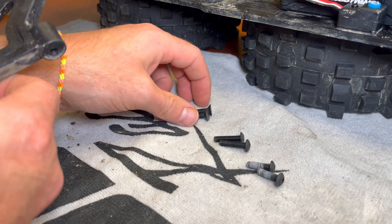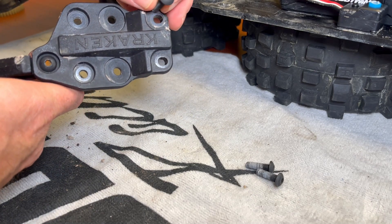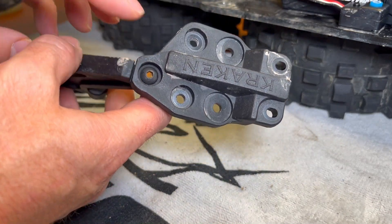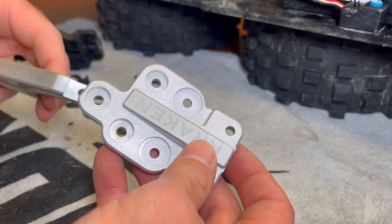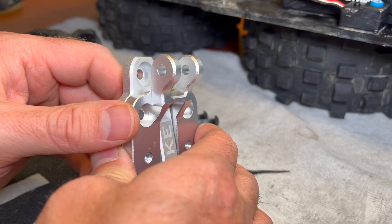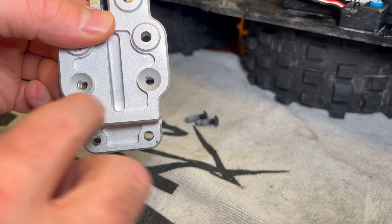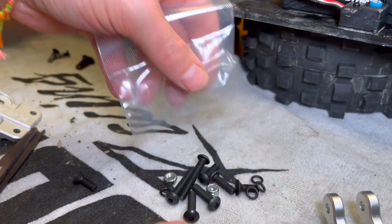One thing to keep in mind is that you want to keep your hardware set aside — know which bolts go where, as a couple of them are reused. The two that go where the steering bell crank is are changed, so you'll end up with a little bit longer one because when you sandwich those braces together it ends up being a little bit more thick than the original. You do need to put that screw in for the center top brace first, because once you sandwich those pieces together you can't access it.